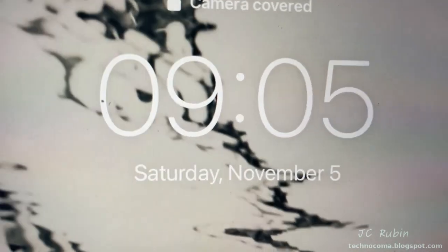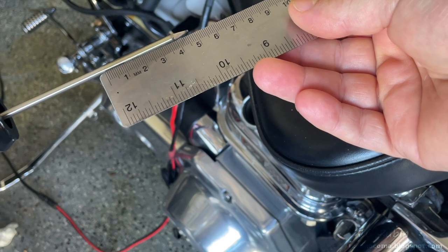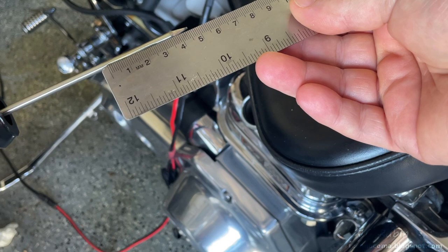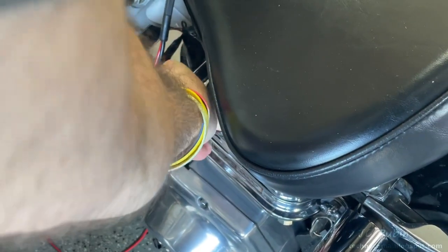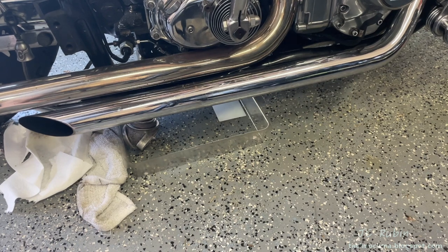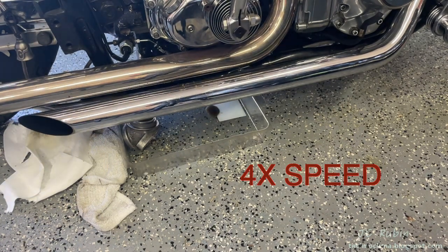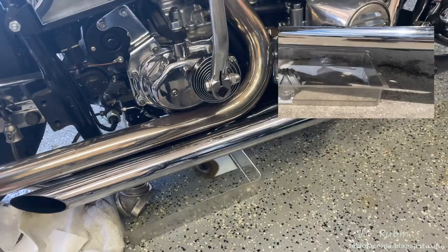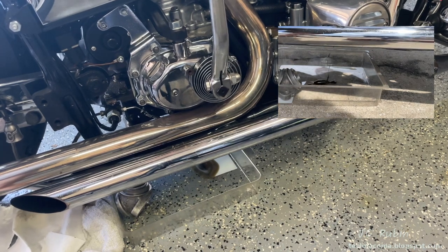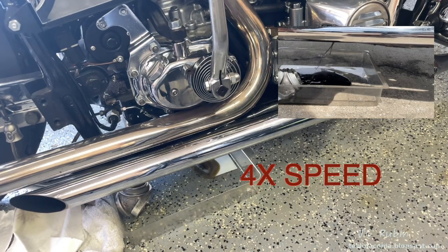We're past two and a half weeks — half a week longer than the initial observation. Looking under the bike I see a really slow drip, but I'm going to reserve judgment because it's not what I think it is. From the oil level test I can tell the oil did not fill up the case causing that drip — it simply wasn't high enough. I never really ran the bike out after the fix, so there was a lot of residual oil in the breather valve upstream of the hose. With the gas off, I'm running the starter a couple times. We can see some oil coming out the bottom — but is it residual? We can already see the comparison against the volume of oil before the repair after the 14-day wait: on the top right it's just a pool of oil pouring out of the engine.